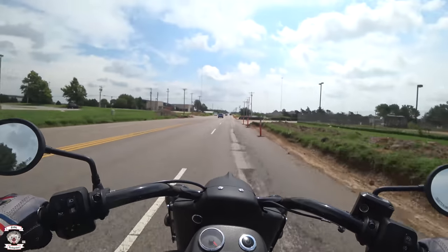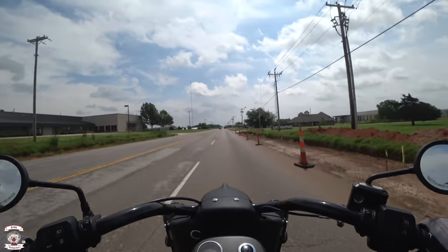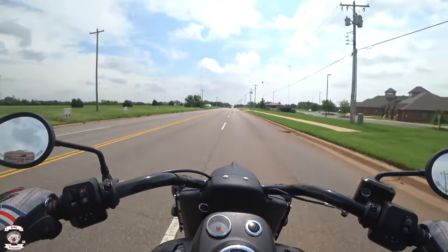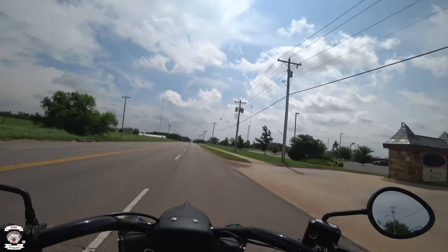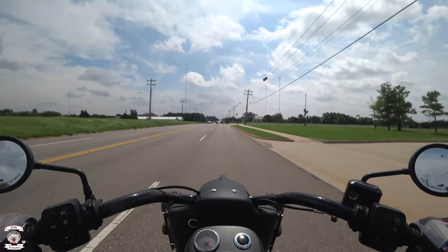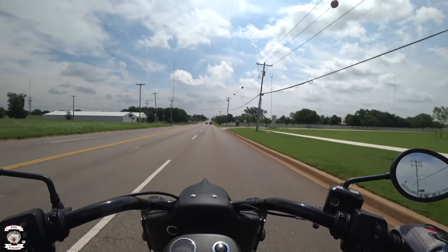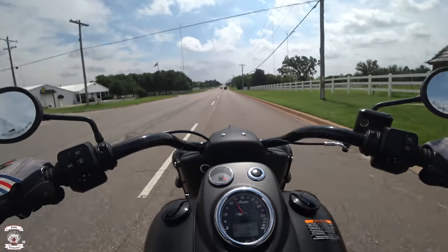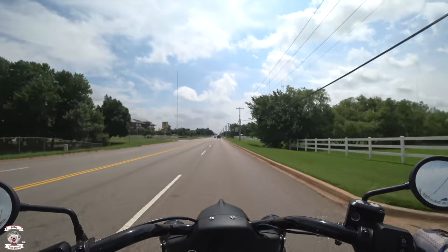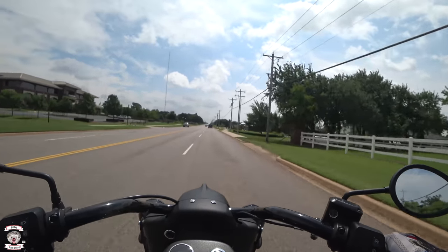If you're a city cruiser with a 45 mph top speed limit, you'll be looking at around 1,650 to 1,700 RPM at 45 miles an hour in sixth gear. The bike still has a little bit of decent pull, but I do recommend dropping a gear at this range because you're not quite in the power band of the 111. It still makes a pretty nice noise for a moment, then gets going — kind of makes that burble noise, which is because it's a smidge bogged.